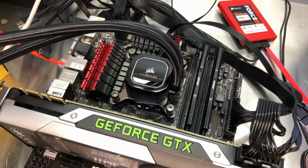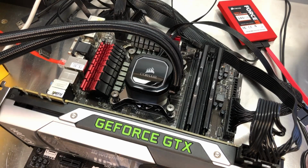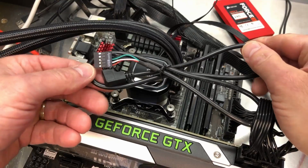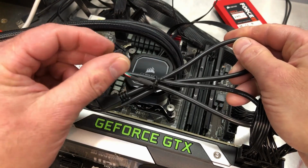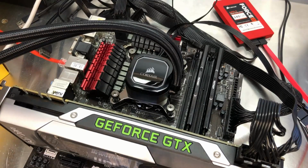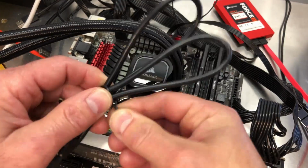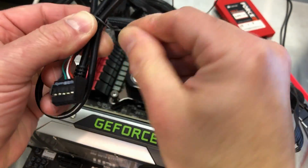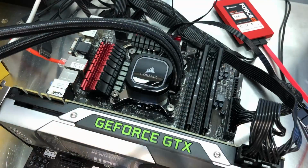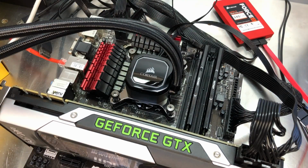And the data cable here somewhere, oh, here it is. This is the data cable that connects to your USB socket on your motherboard, and the other end goes to the pump. So that's what the iCUE software uses to communicate with the pump. So we'll get that plugged in. You can pick any USB socket that is open. Really doesn't matter which one.